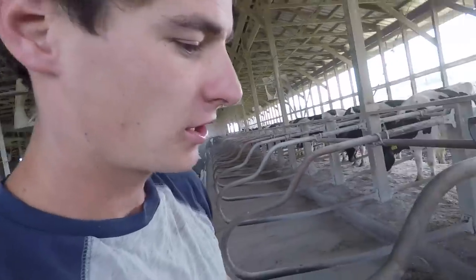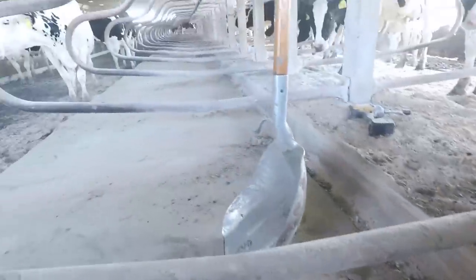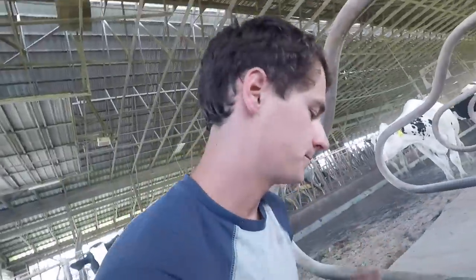Got them cleaned off here. These are held down just by 2 small screws up at the front, one here and one here. Just gotta grind the top of them off, and then the mats will just come right off.